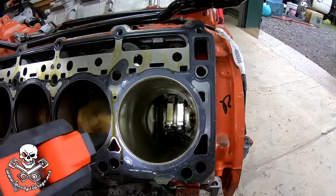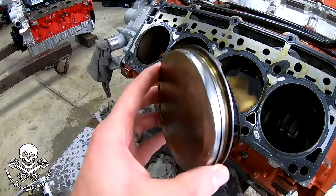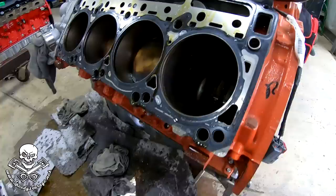It's very odd to have that happen. I've only heard of a couple of Hellcat engines having rods fail, and usually they're at the 1,000 horsepower level. But this one definitely had a problem, and you can see on the edges where it was rocking back and forth in the cylinder. So now we know what our issue was in the data log that was causing that timing to be pulled — it was something in the motor vibrating. See it on both sides. Kind of strange. So at least we know what happened.